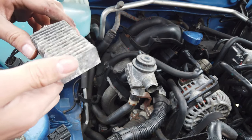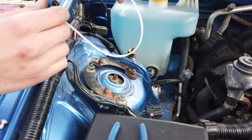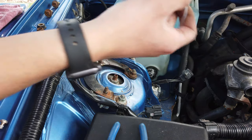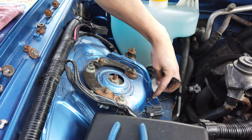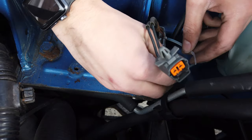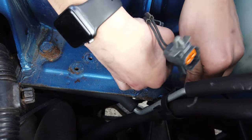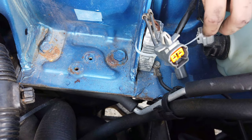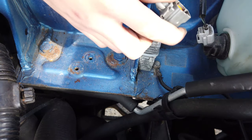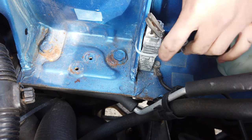You don't actually want to remove the resistor because you need that for the car to run. So this is where one of the zip ties comes in. What we're going to do is slide one end through this hole, stand the resistor up, wrap the zip tie around it, and pull that nice and tight. Then take your snips and snip the end off. Plug that connector back in and just tuck it away underneath.